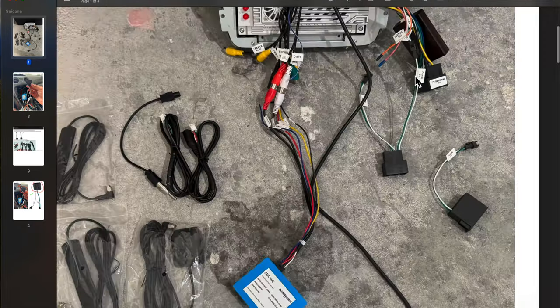Really the only thing we have now is one cable that loops and goes straight into the amp, and the other fiber optic comes up here and feeds through to the radio — that's it, because we removed all the other fiber optic lines. Once you have that installed, go ahead and test your radio. Put it in accessory mode and go to the radio — you should have sound. If you don't hear sound, make sure you unplugged all those fiber optic lines except for the amp. If you still don't have sound, double-check all your connections.